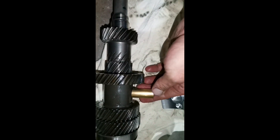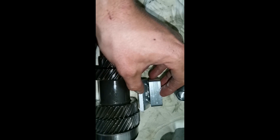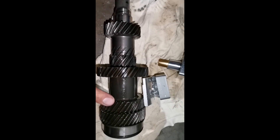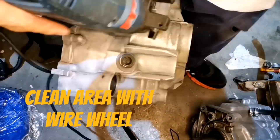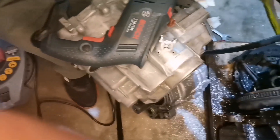The fourth gear support consists of multiple parts. We have a brass which looks like this — as you can see it's cut in half and it will be running on the gear like that. This will be on the inside of your gearbox. This part will be holding the part on the inside of your gearbox, so in between these two will be your gearbox casing. This is the serviceable part where you seal your brass insert and as needed you will be tightening to apply pressure to your fourth gear.